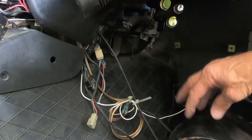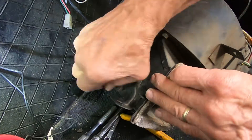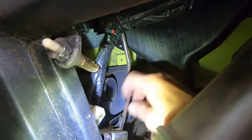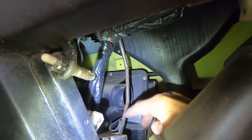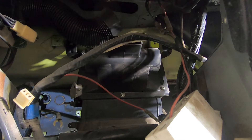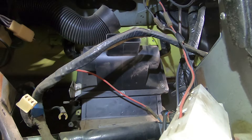Now I think all I have to do is disconnect this cable from this blower motor housing and I think this will come on out then. Now I can get this piece of duct out of the way. You see this brace here - this little support rod? When I try to pull this over, it's hitting right here, and I can't move it out of the way because it's welded here and it's welded up there. There's no way it's coming out on the driver's side because the steering column is in the way. So I think what I have to do is take these screws out here all the way around this piece, and if I get that out of the way, I think it'll come out.